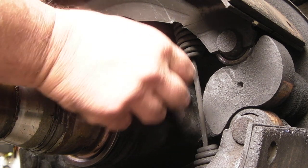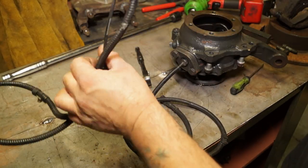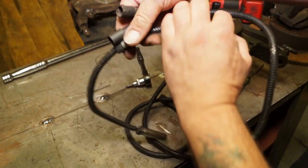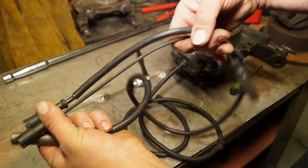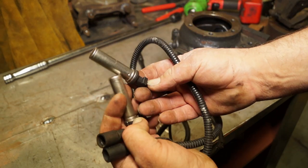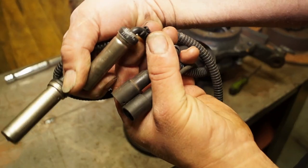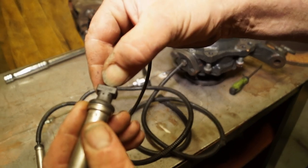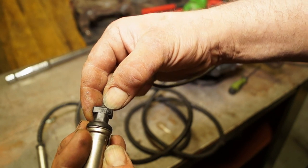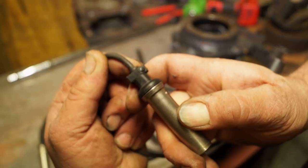This one I couldn't move, so I've knocked it out — I'll clean it up so I can reset it when I put the hub on. These are Wabco plugs, and up to a certain generation you can recognise them. This one here is for the D1, and the other one is for one of our HGV trailers — this is actually for disc brakes. Basically, it's a magnet in there with windings — it's a small AC voltage generator, and you need the exciter ring to stimulate it. It produces its own current. There are S and S Plus sensors — S Plus has a little bit less resistance. You can use these in your Discovery 1s and they probably work out a little bit cheaper.